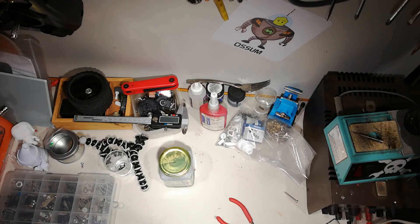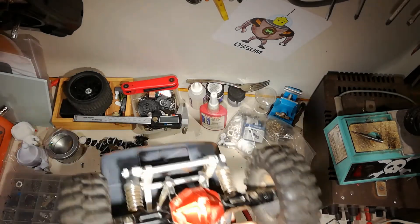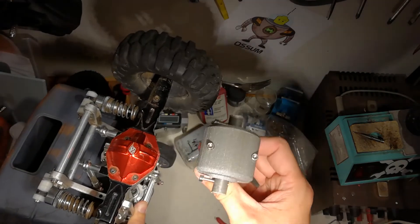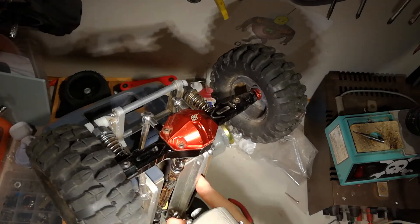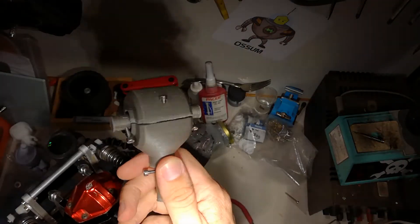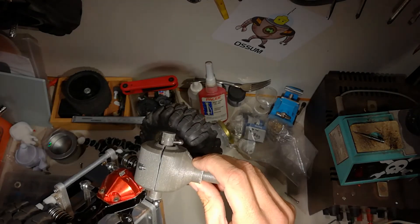Just as a little size reference, because this thing does look enormous — this is the Boom Racing SCX10 aluminium axle, and you can see it's not a whole heck of a lot bigger. We can definitely get it down to that size if we want to. This design I'm actually planning on having pretty much hidden because it's going to be a fairly low-profile vintage single-seat racer where the rear axle would be inside the bodywork anyway. So I'm really much more interested in having a robust diff. This one is just a spool — if we turned it into a spool it could be really a lot smaller. But my goal is to be able to handle at the very least the silver can motor.